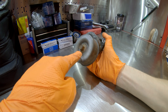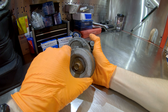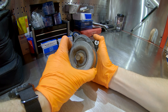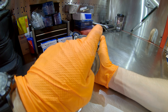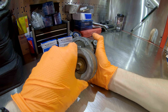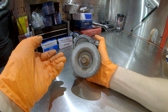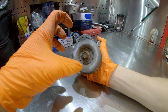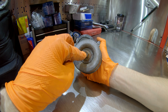The other issue is the front pulley — the bearings in the pulley over time will seize and fail. You can barely turn a failing pulley by hand; it should spin freely with one finger. The problem is these are sealed bearings that you cannot service, grease, or oil. When they're done, they're done. Luckily it's an easy replacement — you remove the bolt, the washer, and the pulley and bearings come off as an assembly. Simply replace it, put your bolt back in, torque to specification, and you're good to go.